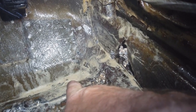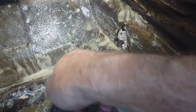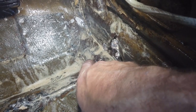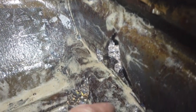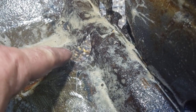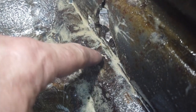This lower bulkhead panel here needs a section cutting out and welding in - that's a small piece. Then another piece in there - if this hasn't rotted through, otherwise it's one section. This level piece would be difficult to shape, although not impossible - depends on its inner lip. We investigate this area and see what kind of piece - it could be a larger piece, but it goes underneath so we do this bit first because it's actually only missing a small section of its edge.